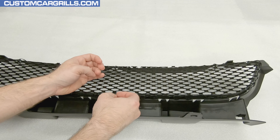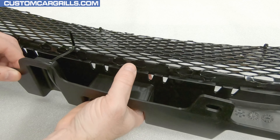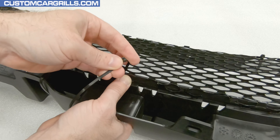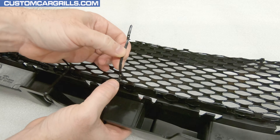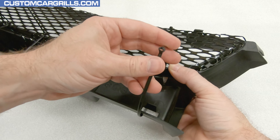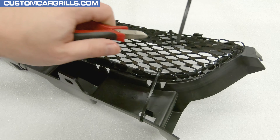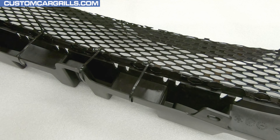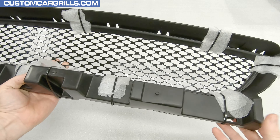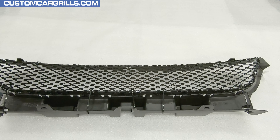I like to feed the tail end through the mesh from the front, and then loop the head around the grille frame and connect them with the head of the tie resting on the back of the mesh. This gives the best hold, and it's important to note that there's no point in over-tightening these ties. I want a good firm hold, but I don't want to distort the grille frame. There's a tricky balance of being too tight or too loose, and it might take a couple tries to get it just right. With the ties in place, I'll make a pass around the back and cut off the tail ends of the ties. Let's flip this around and see how it's looking — the frame doesn't look to be distorted, and the mesh seems to be in there straight and symmetrical.